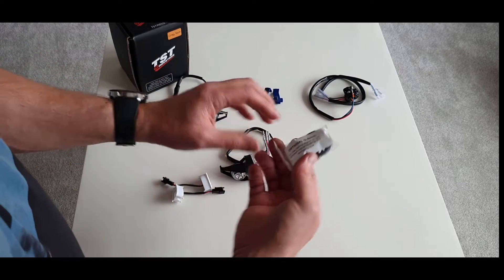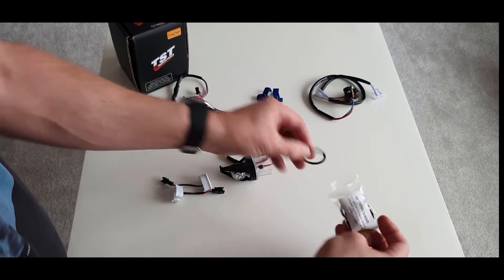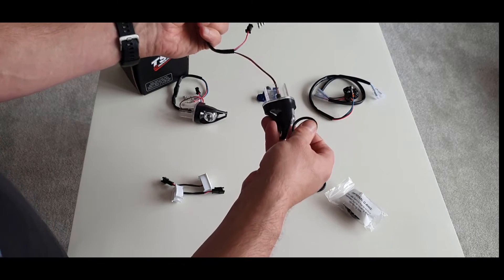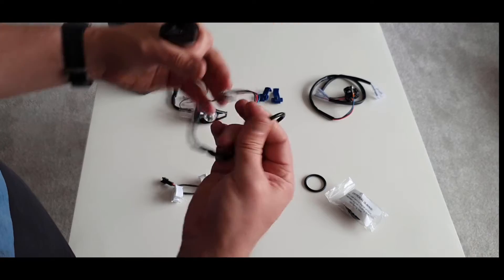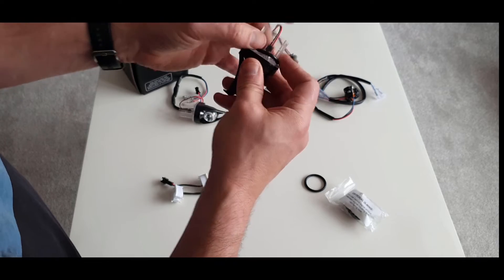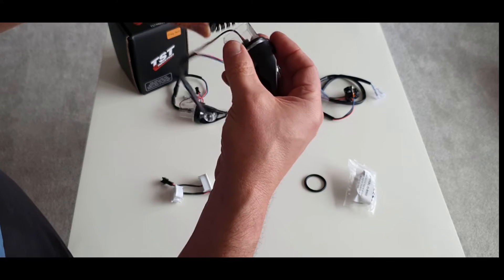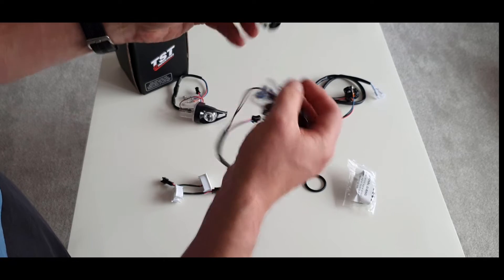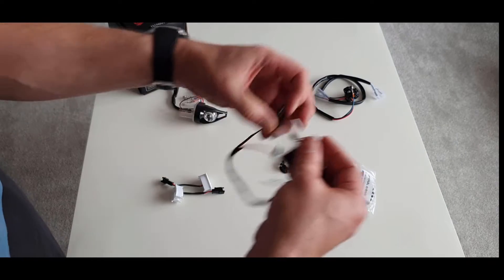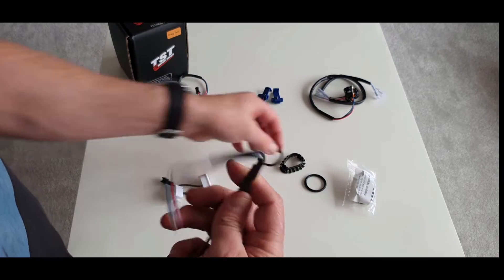The O-ring is for use behind the signal shroud. When fitting it you pop it into your mounting panel at the front, fit it over, then drop the ratchet fixing through the hole - it drops down on top of the claws. To undo it you just pinch them in and it'll pull off. It's a far easier fitting than the standard setup where you're losing fingers and thumbs trying to get the things out.